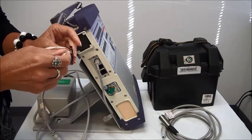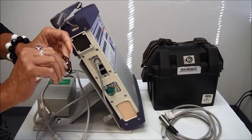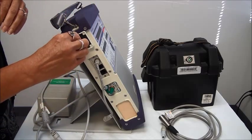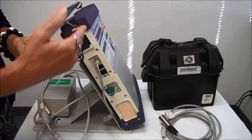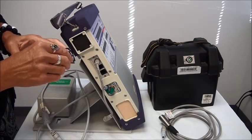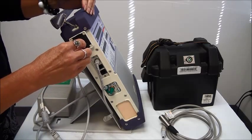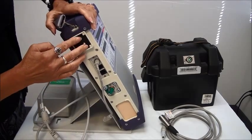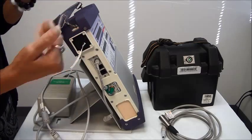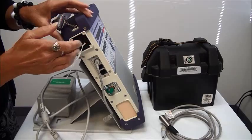You don't have to do this, but it's something you can do. The thing you want to take care of is that you put the twist tie on while the cover is out of the ventilator. You never want to do this while the cover is in the ventilator, because then you can poke something behind the filter and do damage to the ventilator. When you put it back in, you have to push on the sides and it will snap into place. If you don't do that, it'll fit in there real loose and will pop out, so you have to snap it in so it fits in there nice and tightly.